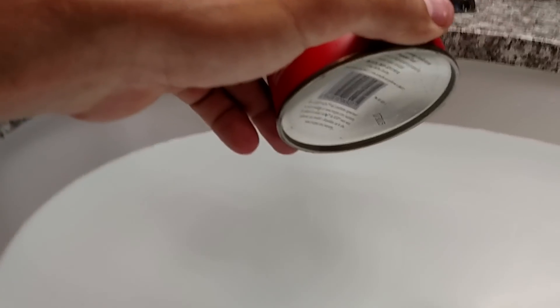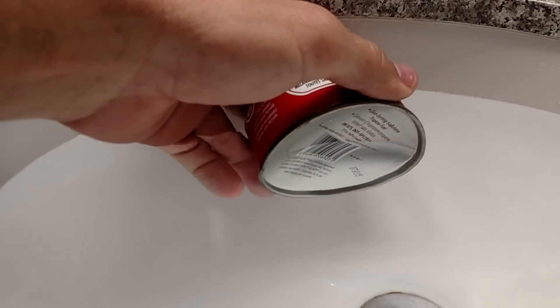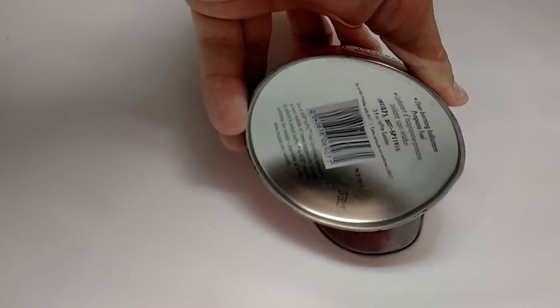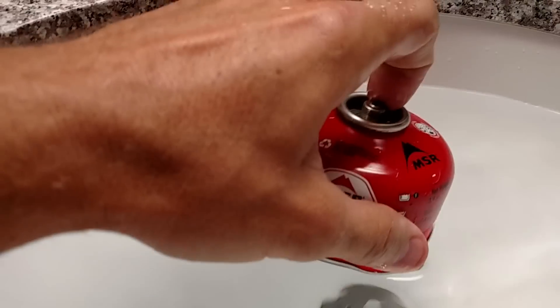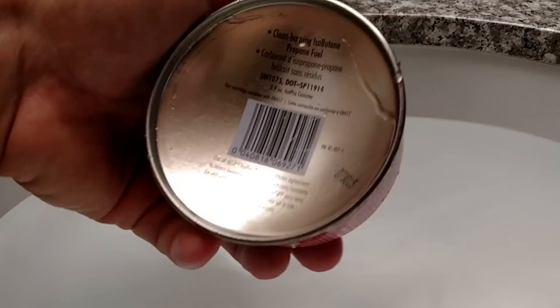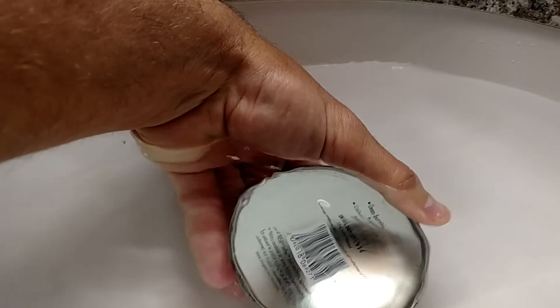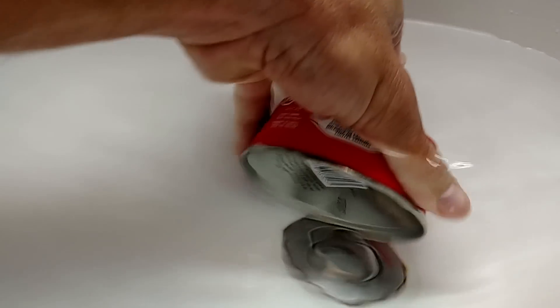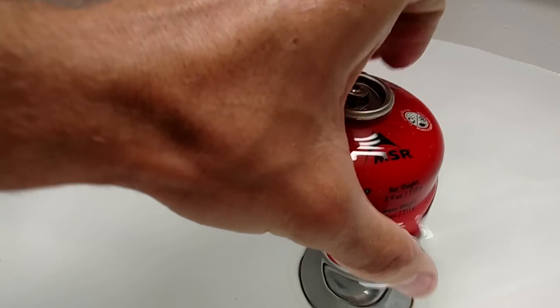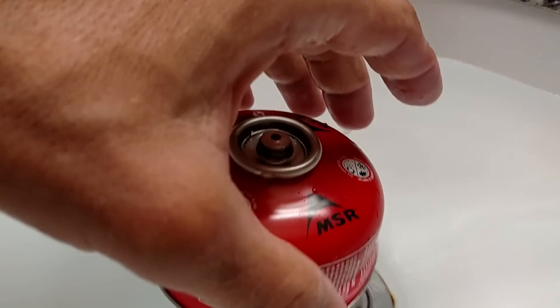So what I do is when I introduce the canister into the water, I make sure that I get underneath it. I want to get the air pocket out because I don't want to set it on top of the air pocket — it'll float too high and it'll tell me it's empty every time. So I have to introduce it kind of upside down and make sure that there's not an air pocket being formed in there. Then from there, I want to just let the fuel canister float.